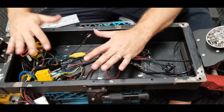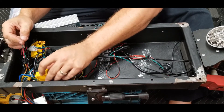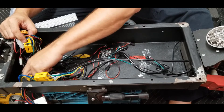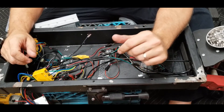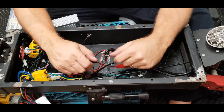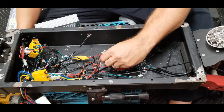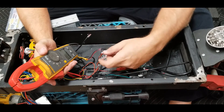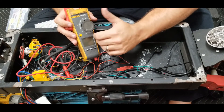Understanding the wiring is going to help you eliminate problems in the future. If you have a short, it's a good thing to come in here and check these connectors every once in a while. To find out what your voltage is on a connector, you're going to have to get a voltmeter. Even the cheap ones do okay — Fluke is a really good brand — and you'll see all these different symbols on the voltmeter.